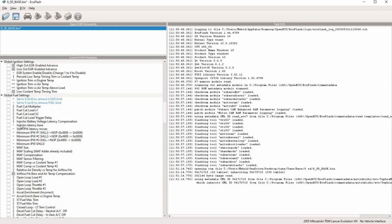your fuel injector base latency, you literally just Google this, and there's a bunch of information available on this. FIC 2150s, incidentally, they kind of tune the same as ID 2000, so you could use the latencies for that. I know for the 14 volts, I remember off the top of my head, it's 0.04, and then you could just scale and follow whatever. I think this was 350 or something like that. This is just a base. You have to adjust this.